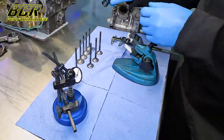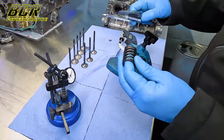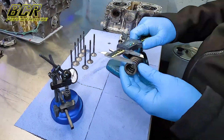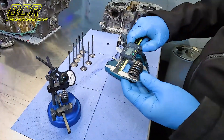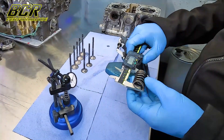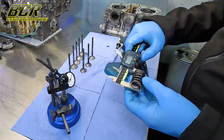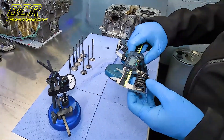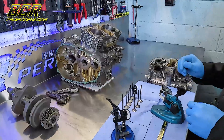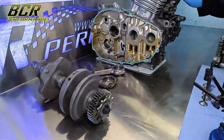So now we're going to move on to the valve spring. Basically you're measuring the free length. Over time if it's compressed repeatedly it will shorten. You get a specification in the Haynes manual for what this needs to be, then you just measure it with your vernier. I put a little bit of pressure on it and let it spring back — it keeps returning to 37.2mm which is fine. Now we'll move on to measuring the block — the housings, the crank and the bores.